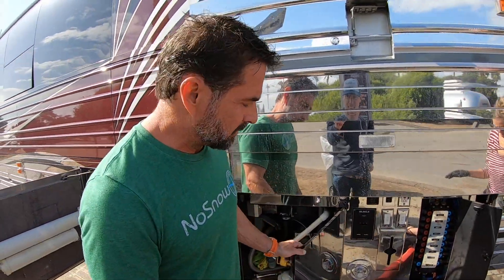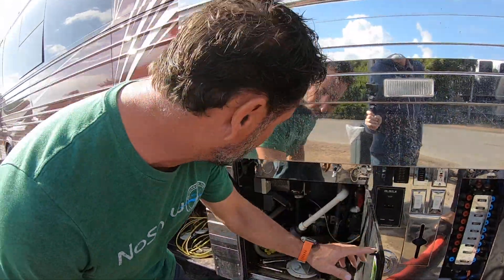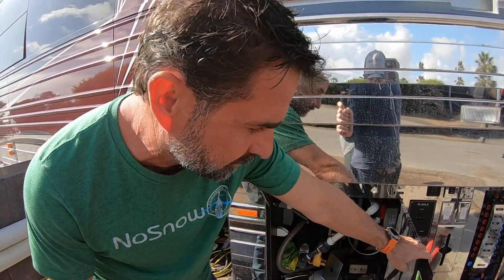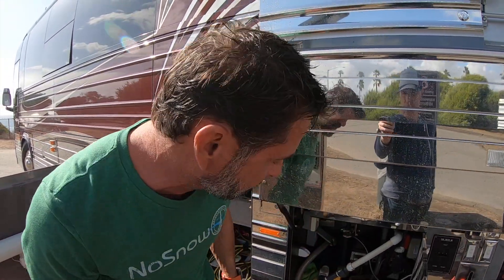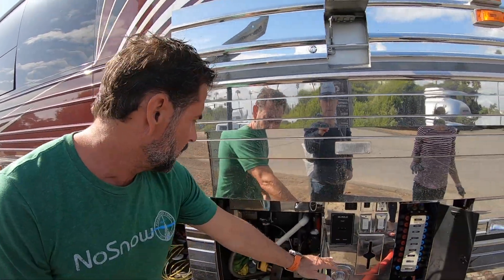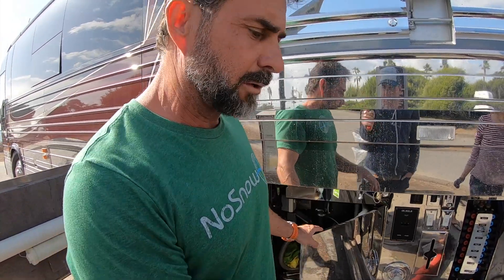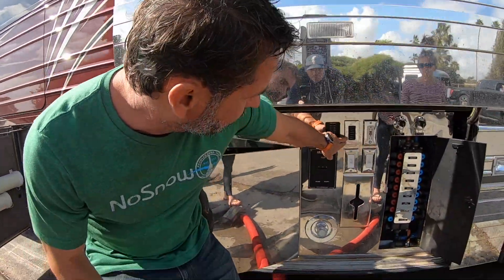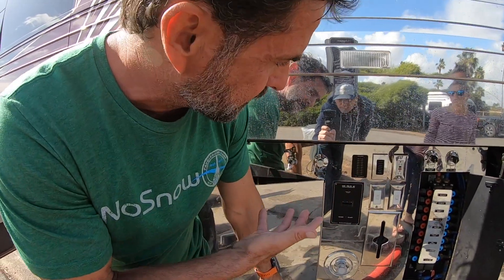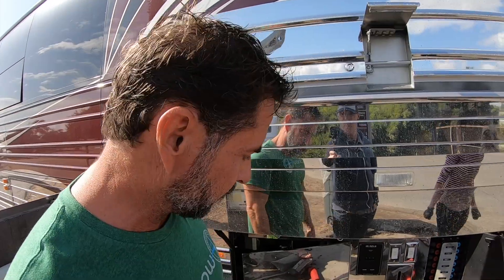The beauty of how Millennium did this conversion is it allowed us to flush either tank or both simultaneously off of our water pump. Our water pump is quite substantial — it's almost like a pool pump style. This is a Mach 5. They are an expensive pump but they are ideal. The other thing to consider with this conversion, which is a little different than your average motor coach, is when we're hooked up to a full hookup site we'll hook up our water hose on a retractable reel. We have a water fill button so we have to hit that to fill our tanks. It does not run off of city water — it always runs off of the pressure of the actual pump. So you never have pressure issues, you can never blow plumbing fittings out, and that is a safe measure for the coach itself.